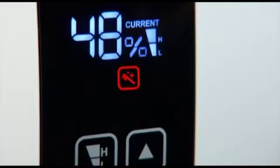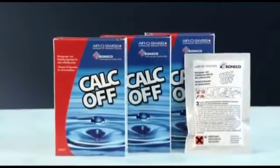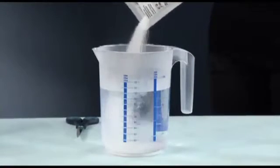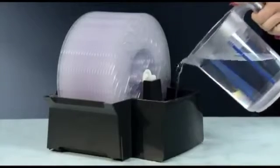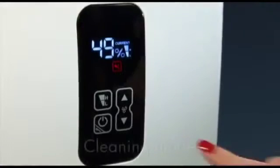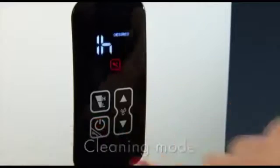The cleaning icon is a reminder that the unit has to be cleaned. To clean the unit, we recommend to exclusively use Calc-Off, which is especially composed for air humidifiers. Mix the decalcifying agent Calc-Off with clean and hot water — one pack per one liter. Remove the ISS prior to cleaning. Fill the mixture into the base and put the upper part back into place.